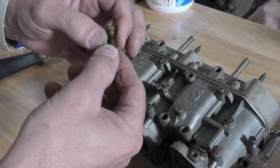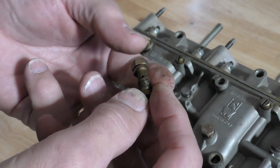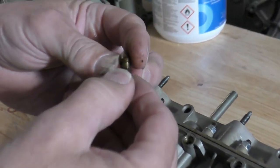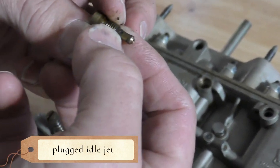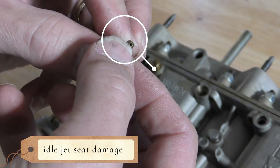Same on that one. It's growing stuff — nice black disgusting chunks. Missing the O-ring, which is not a major deal, but you can see the idle jet is also plugged. These wouldn't really have run at all. Also been over-tightened on the seat.